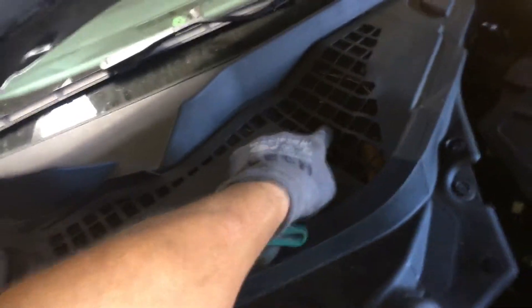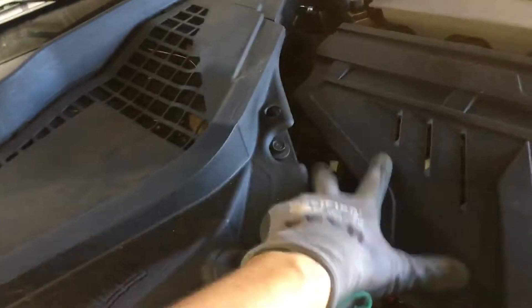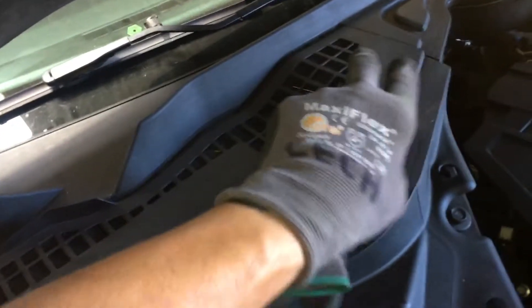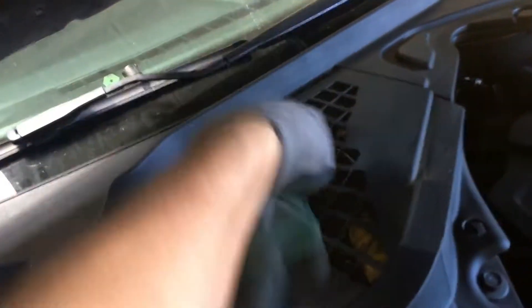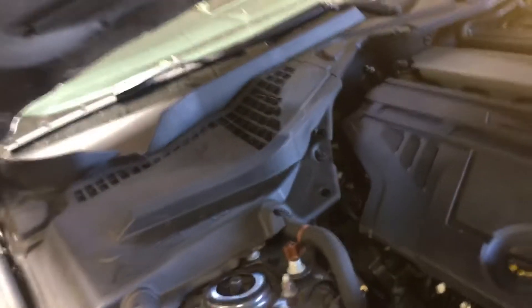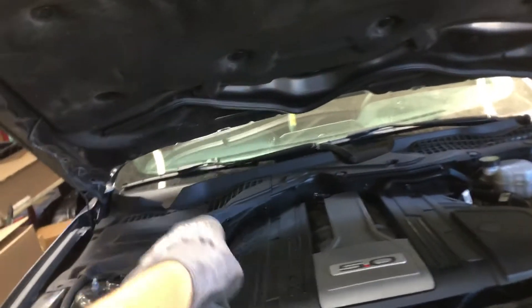Missing tiny little rubber seals — like this one at your fresh air vent intake to your evaporator right here. The body shop did not put on this little rubber seal that seals here to keep out the 200 degree high-pressure air. This is a low-pressure air point — when driving with AC on fresh air mode it's supposed to draw outside air from here, but instead the hot engine air goes directly up and feeds almost 200 degree air right into your evaporator. Then you go to a mechanical shop, he starts replacing parts and doing recharges, scratching his head. Body shops leave this off, and without that seal you're feeding 140 to 200 degree air right into the evaporator.